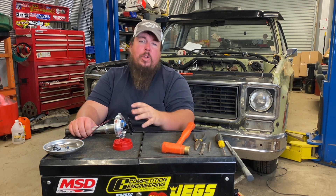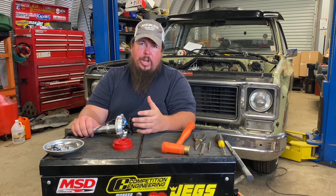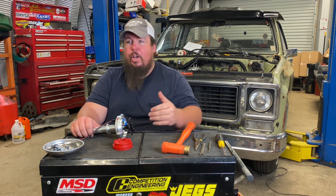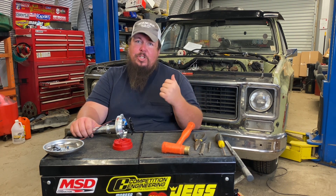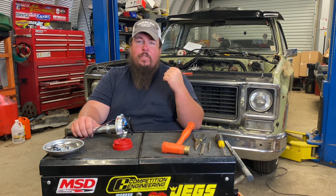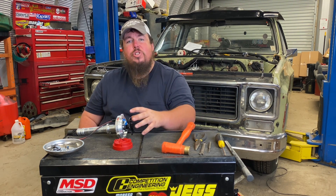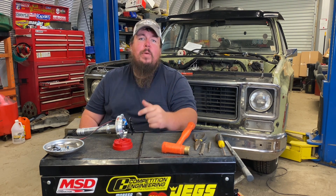But what I'm doing is I'm actually locking all these features out. I don't have a whole lot of time to be trying to tune all this stuff — I live too far away from the track and I'm actually trying to get this truck running right now to go racing. It's a Wednesday night and I've got to have this truck on the trailer ready to race Saturday for the first race of the season. I know that locked-out timing works really well, so I'm pulling this distributor apart and locking it out. I'm going to show you step by step how to do it.